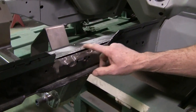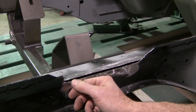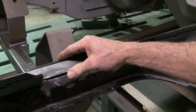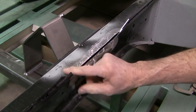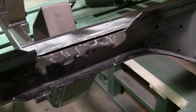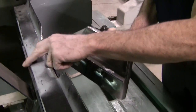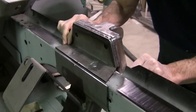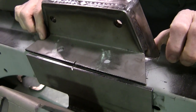Now we're going to show you how we got this part here cut out, but we left the other side over there. Now on the other side when we cut it, we're going to leave this lip up a little bit higher and roll that in so that this gap is going to be a little tighter than what we got here right now. But this will work — we are going to weld this completely up, then we'll grind it. Now we're going to show you what the upper bracket looks like with the notch in it, and we're going to go right up here and see how those two line up. That's exactly what we want right there.